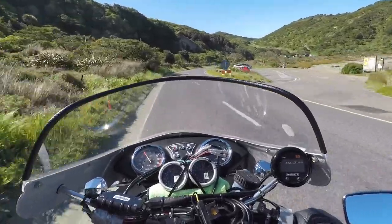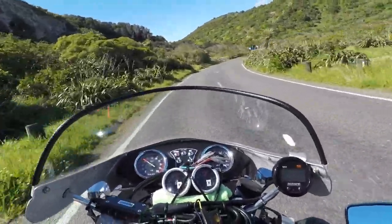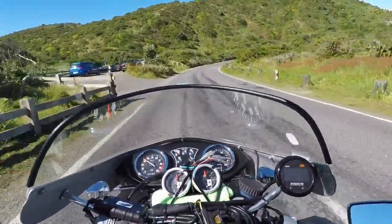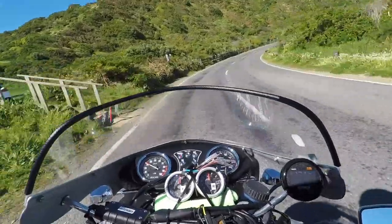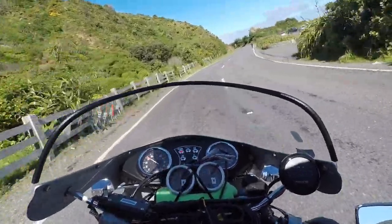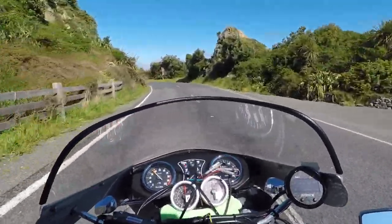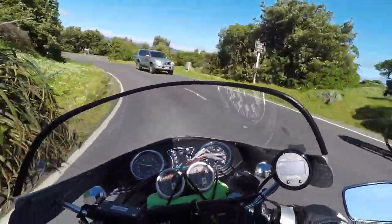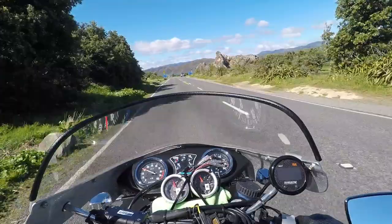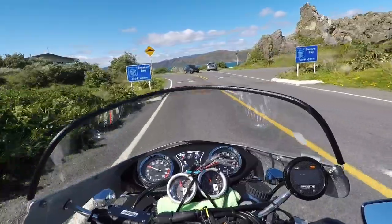Hunting a bit. And when I crack it on, it goes rich, which is what you'd expect. But would that cause it to sort of feel a bit anemic? Go down as much as 9. I'll bring it on and then I'll let it settle at that speed. I get the impression it's consistent around 10.5 to 11 whenever I'm riding at a constant speed, regardless of the RPM and the throttle.